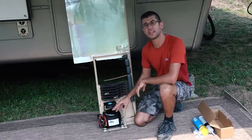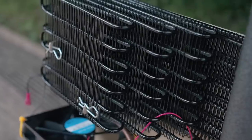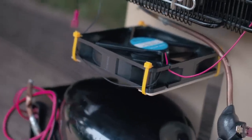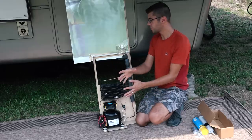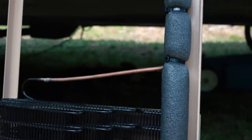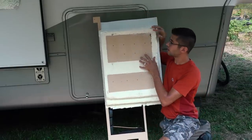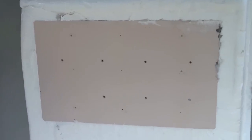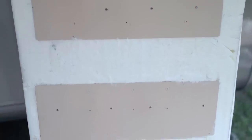For the 120-volt version, you simply plug it in where the 120-volt heating element was. The unit compresses gas, which heats up in the condenser fins. A fan blows air across those fins to reject heat — all on the outside back of your refrigerator. The coolant then runs up into the evaporator using a capillary tube style evaporating unit. The coolant lines run first up to the freezer plate on the back, then continue down to the refrigerator section, connecting into the back of our fridge.